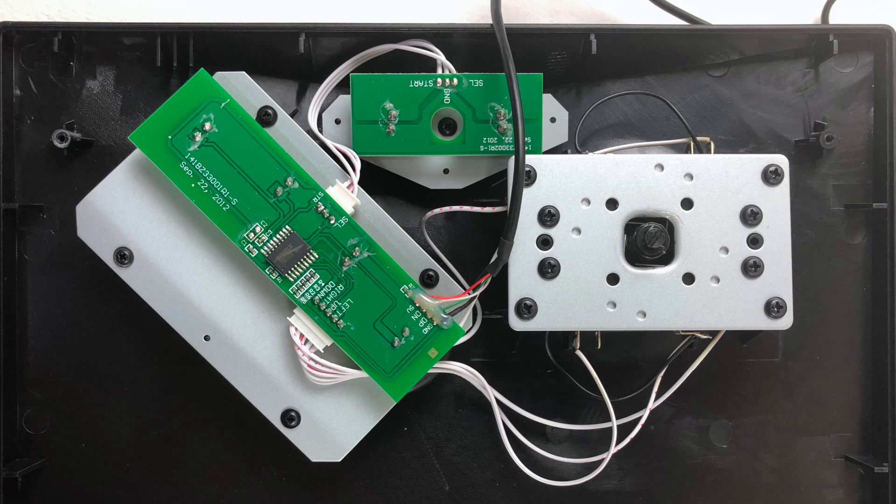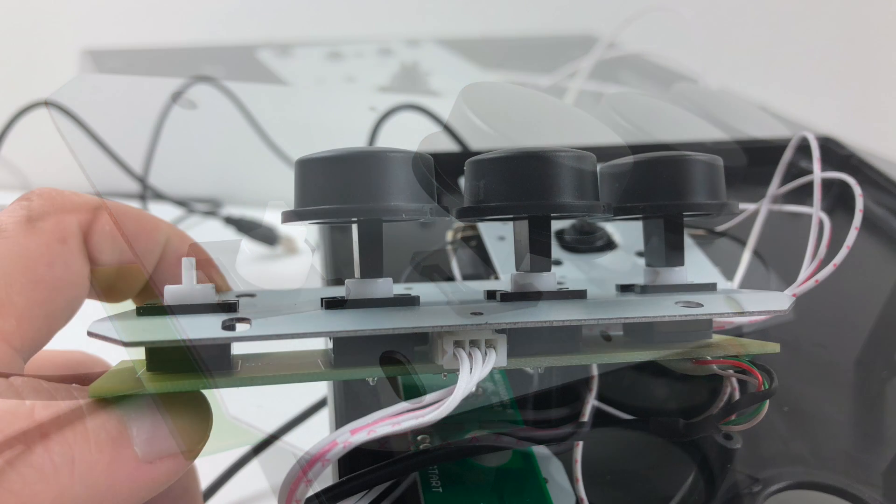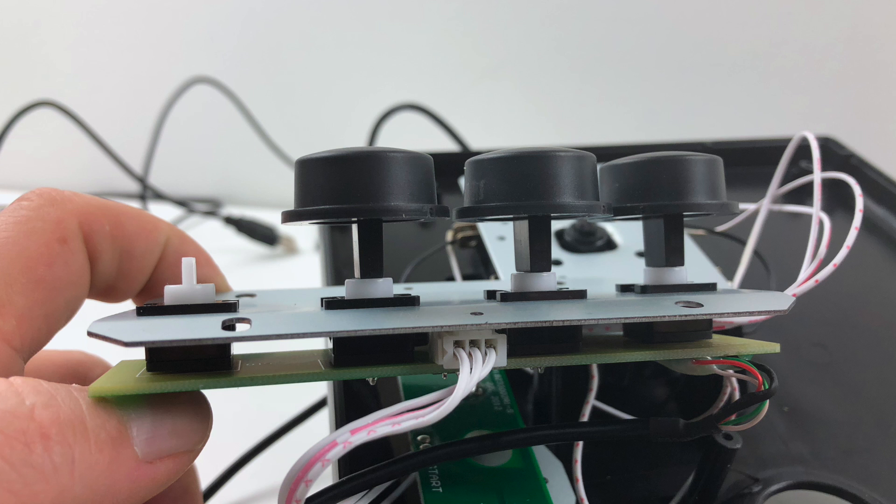Here's a quick look at the internals. The stick itself is pretty easily upgradeable. I do have some Sanwas laying around that I could throw in here, but I'm not worried about the stick itself — I'm really worried about the weight. One of the other issues I don't like is the switches they use. They're not hard enough; they feel very soft. You could try to tear these apart and put a better spring inside, or you can add a better switch itself, but they're soldered to the main board. There's a couple of ways around this — you could add a USB encoder in here, you could find switches that fit exactly, or you can add some Sanwas, but you will need to wire them a little differently.